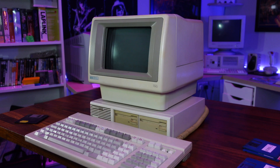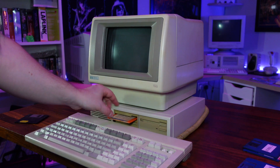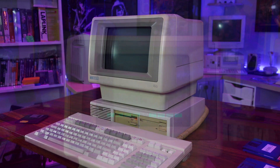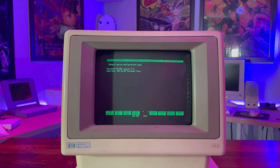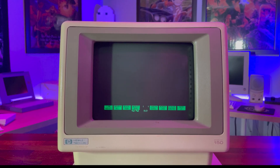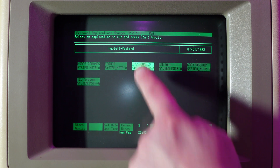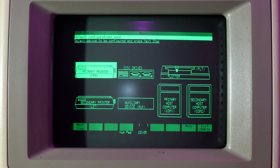This example comes with the bundled MS-DOS operating system on a floppy disk. We just need to insert the disk, turn on the disk module and the computer, and wait for it to boot up. This will load up the HP-TOS, or terminal operating system, which is based on MS-DOS version 2.11 in this case, though the 150 also shipped with DOS 2.01 or 3.2 depending on which disk module you had. This shell allows you to quickly make changes to the configuration of the machine, enter into pure DOS mode, or quickly access applications found on disks in either drive bay.